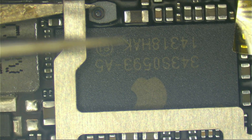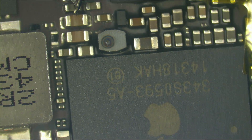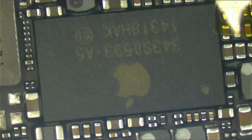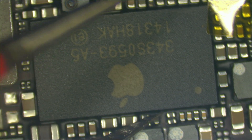What I wanted to call your attention to with this Mini is the power management chip. Specifically in the Mini, the power management chip is encased in underfill, and underfill will protect and go underneath all the little tiny solder balls that anchor that chip. I'm going to cut this bracket so that we can get some visibility on the PMIC chip. This is the PMIC chip — it looks like a tar-like substance, a black sea surrounding all of these components. It's injected as a liquid to really adhere the chip to the device. This chip is sitting on an array of solder balls, and it provides a huge amount of stability of the bond between the chip and the board once it cures to this very rock-hard substance.